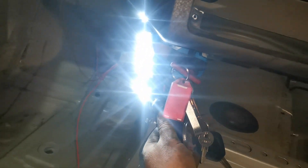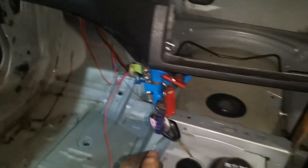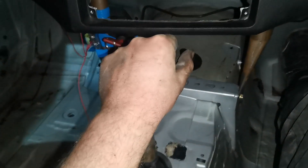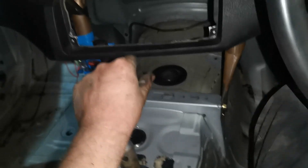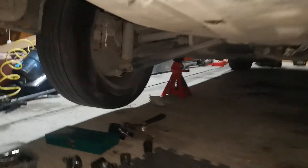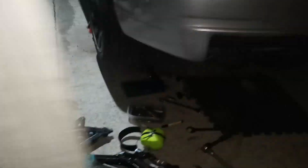We've got a low oil pressure light — so low oil pressure warning on startup. There's the start button — she is. Oil pressure has come up, should go to idle, which it has. Put it into first. That should be rotating — both wheels should be moving. That's rotating, that's rotating. If I try to stop one, the other one should keep spinning — I can't stop that. The other one's still going, so they've both been driven at the same time. That's a success!